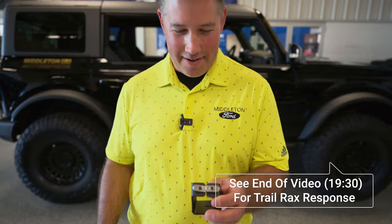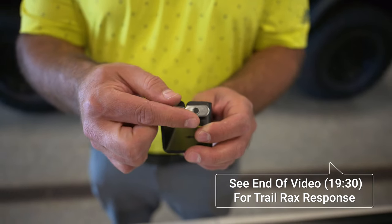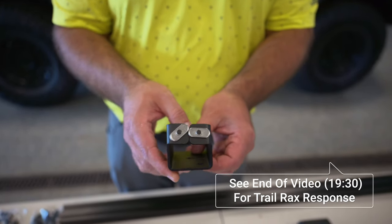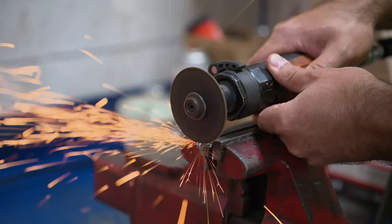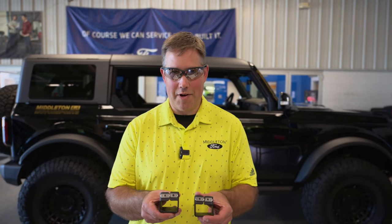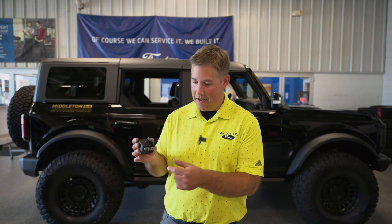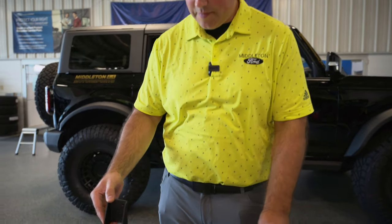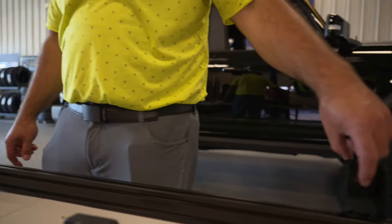I don't think this is going to work — these are overlapping here. We're going to have to cut one of these so that they can line up. I don't know if these are the right brackets or they're just mis-manufactured, but this will not slide into the rail the way it is, so I'm going to have to modify this somehow. All right, this will work much better now — you should be able to slide these into the rails. Now that we got this trimmed up, it should slide in there easily. Make sure you have the arrows on these brackets pointing to the outside of the vehicle. Arrow out — we already got this one on here, arrow out.